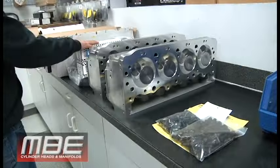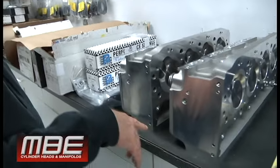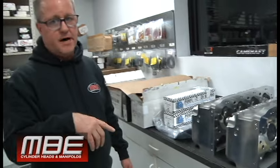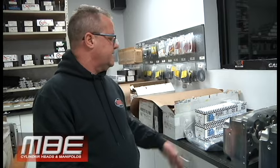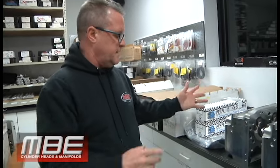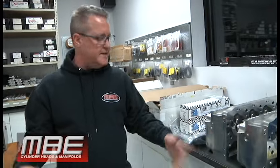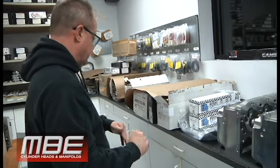And then valve springs and things like that. So this has different intake and exhaust springs. Not always do we put the same valve spring on intake and exhaust. If the lift varies enough, we need to put a different valve spring on the exhaust. So we will always do that, just to keep refining things. And the cool part when you do it, it gives you 8 spares of each. And if you're buying something like this, you're going to want to have a few spares anyways. But just trying to be meticulous on everything.